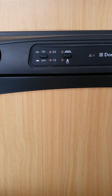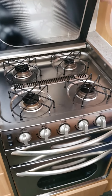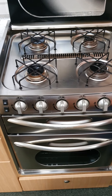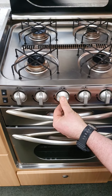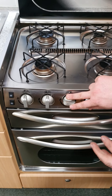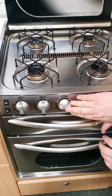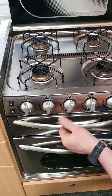To turn the fridge off, just press that. This is your range top and oven system. You've got your glass panel which lifts up and your four gas burners on top — nicely and clearly indicated for each burner as well. Very similar to a barbecue: push them in, turn to the large flame setting, hold that in, and you've got your little igniter switch. This igniter switch does all of them — the four burners, your grill, and your oven. Hold that in, hit your switch, and once it's lit you're good to go. You can then adjust your flame from there.